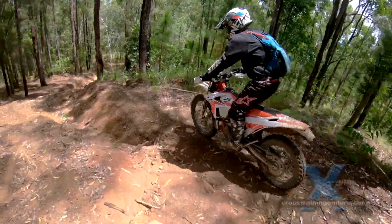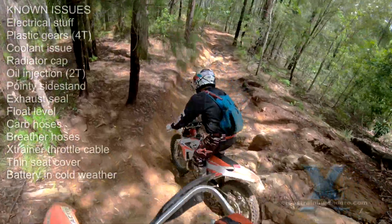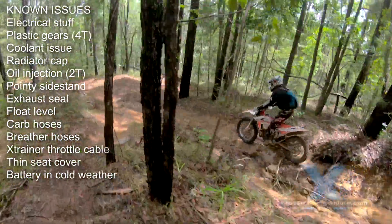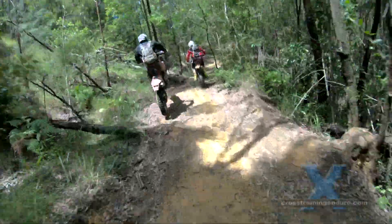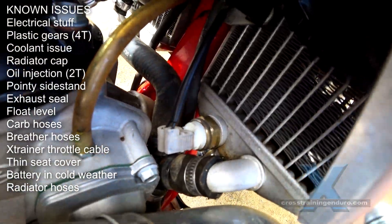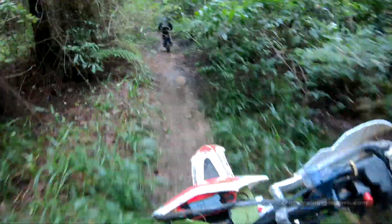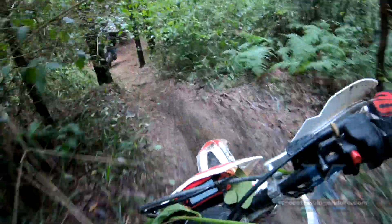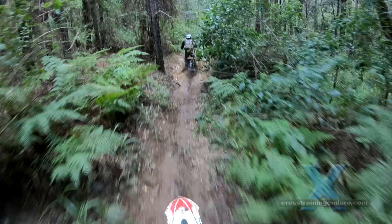All the 2018 models have lithium batteries which don't like cold weather. Simply use a short stab of the starter button to first warm up the battery, then it will deliver the power needed for starting. The thermostat housing can rub on the left-hand radiator if it wasn't positioned carefully in the factory. Loosen off the cylinder head coolant hose and left-hand radiator lower hose and twist gently. Remember to check all your hose clamps too — sometimes these aren't done up tightly at the factory.